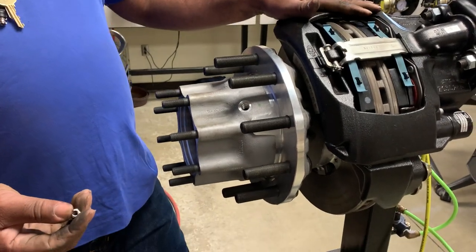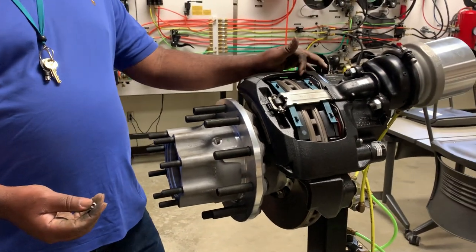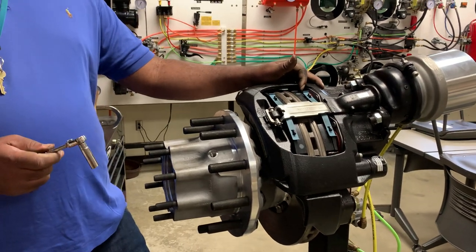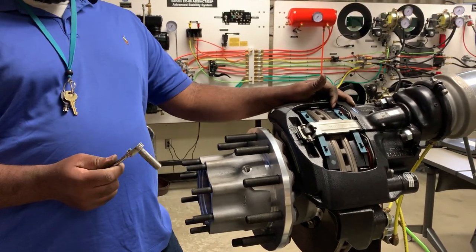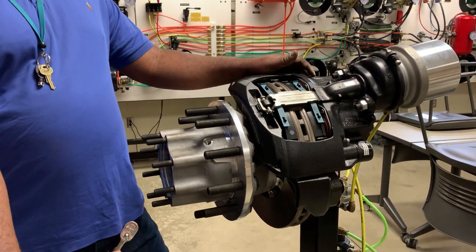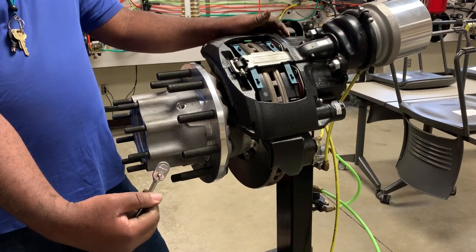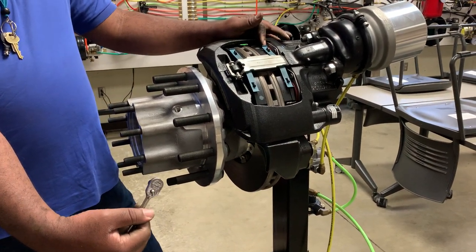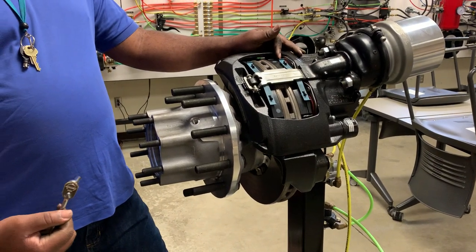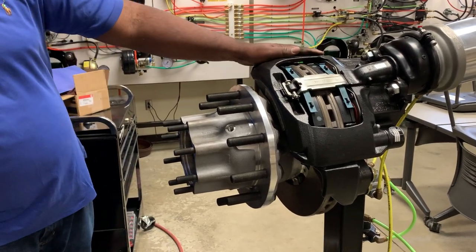That's the reason why I release the brakes — so I don't have to worry about turning it in the wrong direction and snapping the shear adapter. The easy thing to remember is it is still lefty-loosey, righty-tighty, meaning that if your ratchet is set to off, that will back the tappets off, and when it's on, that will push the tappets in or get tighter against the shoe. Keep that in mind.